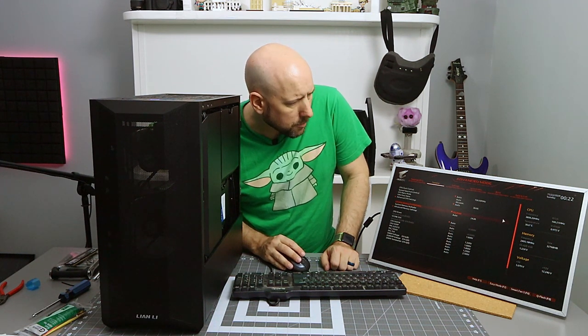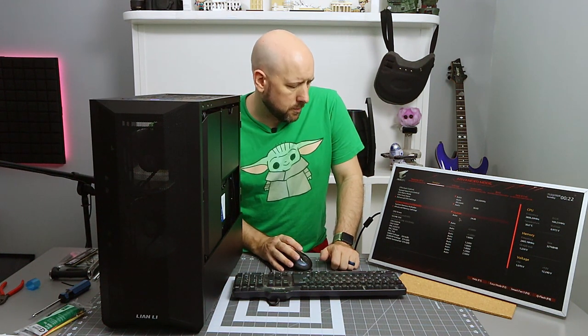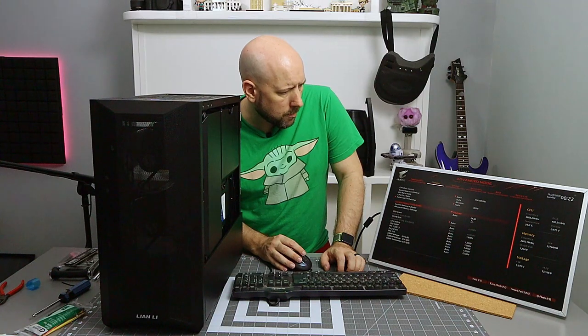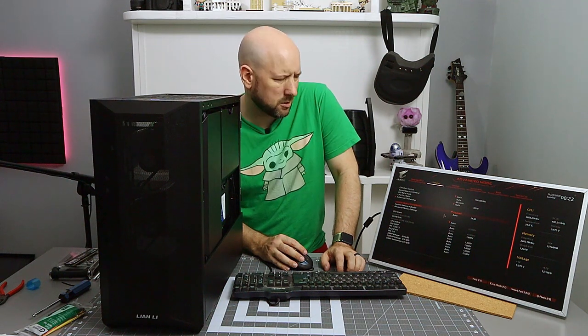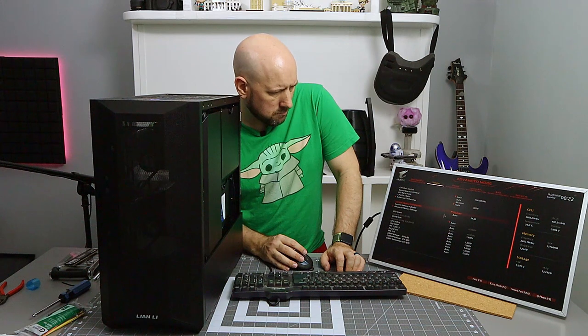Hmm. All right. Well, the boot stuff is what I really wanted to check. I'll come in here and tweak this all later. The main things that I want to do is make sure my memory is running at 3200. Make sure my boot stuff is right. Turn off, what is it, the CSM, the compatibility mode stuff that just slows down and messes stuff up. And then, you know, make sure temps and stuff are set okay. So for now, I think I'm good.